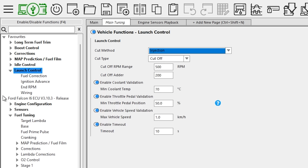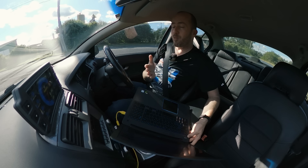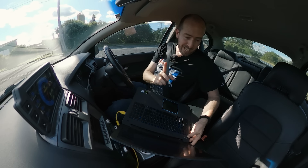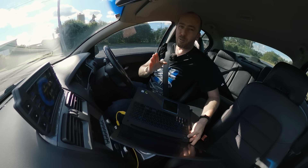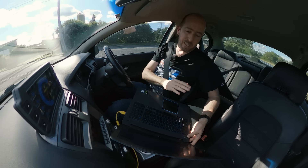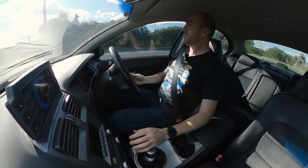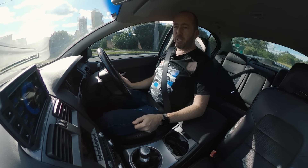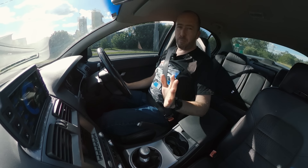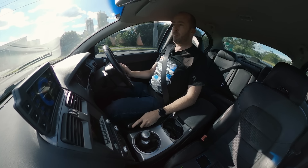The Haltech has lots of settings to look at too. We've got launch control — I've currently got it set to 2200 RPM. When we take this thing to Willow Bank Raceway, which is about to open up again, this will be cool to help on the runs. You could bring the laptop, really dial in a good launch control RPM, let the clutch out in the same manner, and fine-tune your launches. So let's try it: clutch in, first gear, above 75% throttle, and floor it.